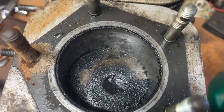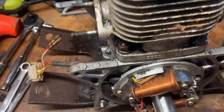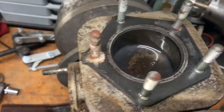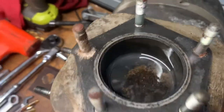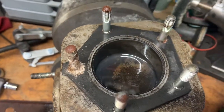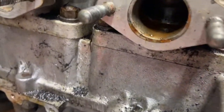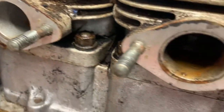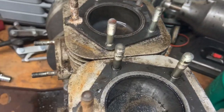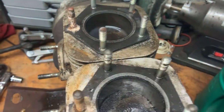I have to replace this piston — it would probably run best with a new one. The next thing is to remove the cylinders. This one is most likely the one to come off easier. Oil is leaking out the exhaust port, so there must be some stuff getting through the rings. I think it might be the bearings that are seized up rather than the cylinders. You can see rust in the intake ports, and there's a bit of corrosion on the fins on the outside. The ones under the cover are nice though — that cover really protected them.